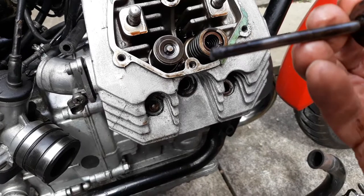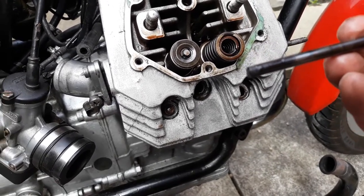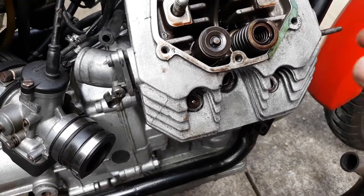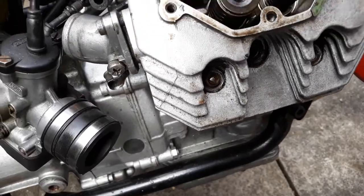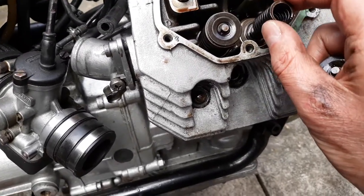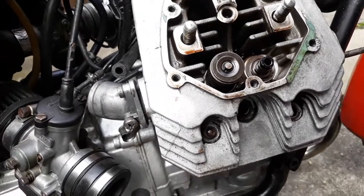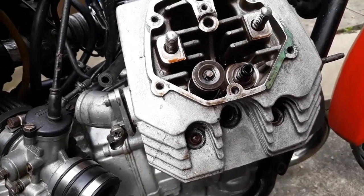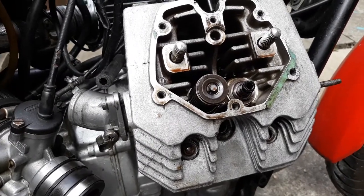As I feared, it's quite a major job. We can take the exhaust valve springs out — there are two springs. The springs will be fine I'm sure, but we've lost the exhaust valve — no wonder it was rough and clattering. At least the engine hasn't actually seized.